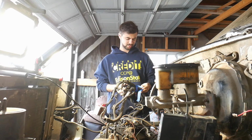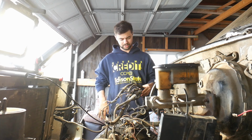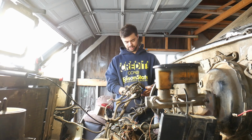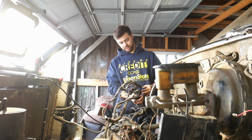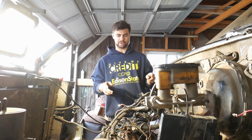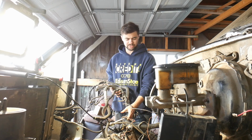Motor mount's on, and so now I'm gonna start running the wiring over along the firewall, putting on the distribution blocks on the firewall and all that good stuff. Really, I'm running it before I put the motor in, because a lot of this stuff will be in the way sitting over here. And once the motor's in, it's gonna be a lot easier to find where all the plugs go when it's already run and everything. It's a lot less of a mess, a lot less of a headache. It'll make things go easier.